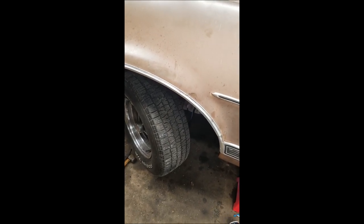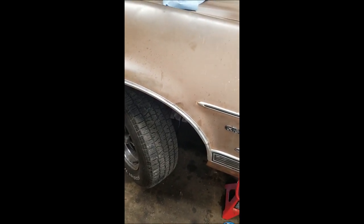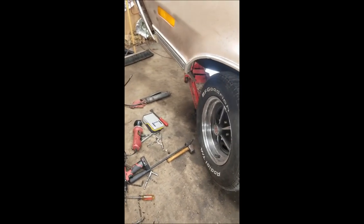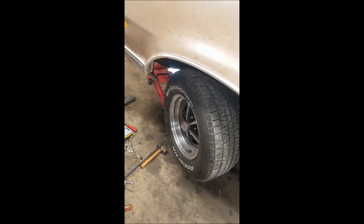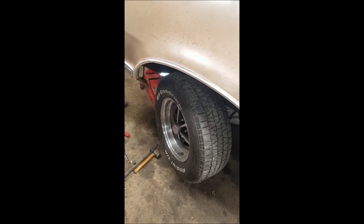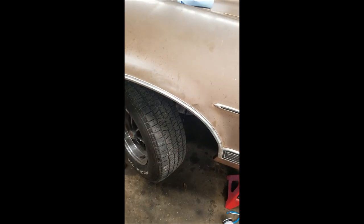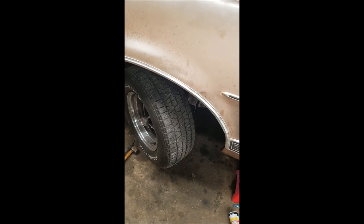Just like when I was trying to put the gearbox up in there and get stuff aligned, the shoulder was not happy. So on the other side, I took the cutoff wheel and tried to buzz through the top of the head, and the rivet didn't work well. I got it cleared enough to see where the center needed to be in the rivet, so I hit it with the punch and drilled through it from the top. Got it punched through. Did the backside, got that punched through. Pry bar, popped it off, and the new one went in.